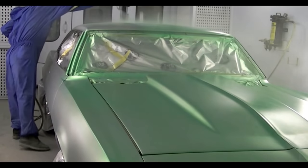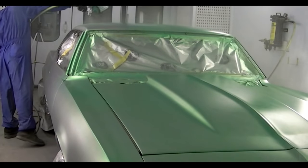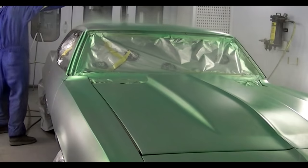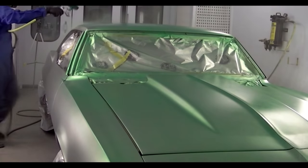Now the roof's probably the hardest part to spray. You can probably see my gun's angling slightly while I spray it. That's just, I think, my vertical limit taking over, but I think I've tried to compensate by turning my gun sideways a bit at the same time and getting as even spray in the middle area as possible.